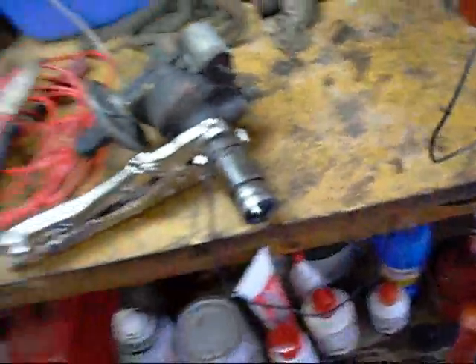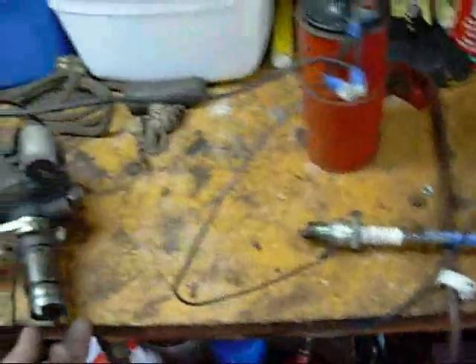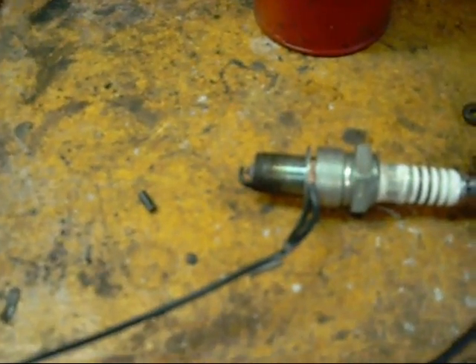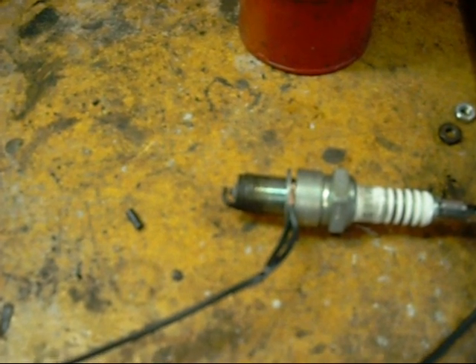A rather old one. All I'm doing is setting up this little Bosch distributor and using the points to make and collapse the field in the coil. The condenser does its part too, because you're going to get a very weak spark without it. All I do is hook up the negative trigger to the distributor and negative to battery, and turn the spindle — and that coil is working nicely.